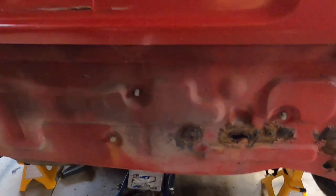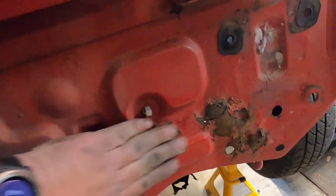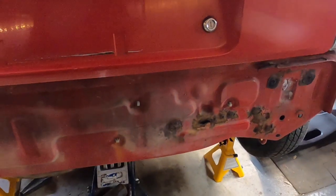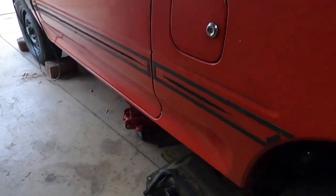"Crustiva" is not a term I would use for this car at all. The only crust I found really is on the exhaust and a little bit on the rear of the car behind the bumper when I took it off. Let's go around the other side and pull the tank out. There's that rust behind the rear bumper — just one little hole, and a little one starting there. I'm gonna go to a junkyard, trusty sawzall, mow all that out, bring it here, weld it in — Bob's your uncle, done.